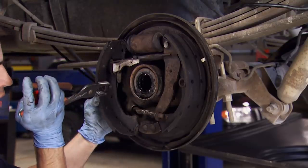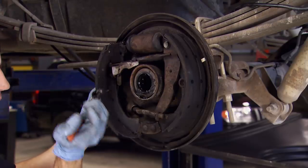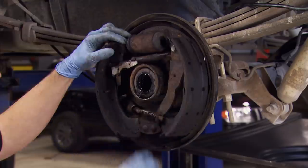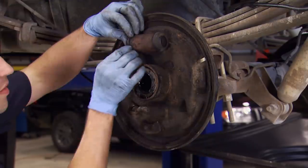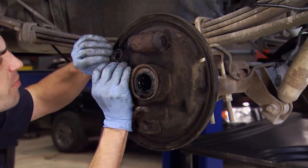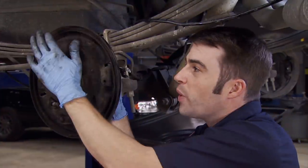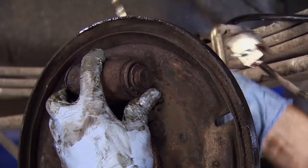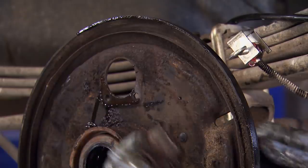They do make special brake drum pliers and tools just for this job, but you can typically get by with common hand tools you probably already own. If you're not too familiar with working on drum brakes, just leave the other side completely assembled — that way you have a reference. These wheel cylinders are rebuildable, but it's usually not cost or time effective to do so, unless you've got some rare vehicle where a rebuilt one's not available. It's a good idea to loosen up the brake line connection to the wheel cylinder before you unbolt it from the backing plate so it doesn't spin on you. We also plugged the end of the brake line to make sure all the fluid didn't drain out of the line, which would just make bleeding the brakes take that much longer.